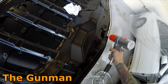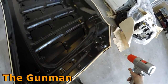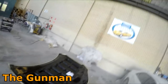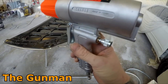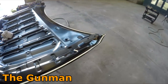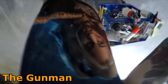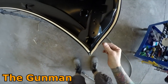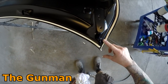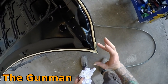I like the minimalistic side of it — there's not many parts in there to go wrong. When people ask me whether they should get air tools or electric tools, mainly my answer is: if you've got a good quality compressor that you can rely on, you're best off getting air tools. With electric tools there's more things that can go wrong — usually it's your brushes and stuff like that. With air tools there are less moving parts and less that can go wrong. So in a panel shop, you're best off always going for air tools.